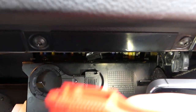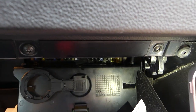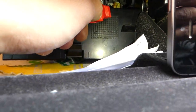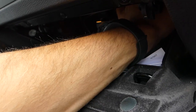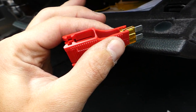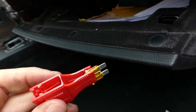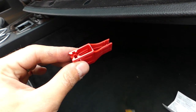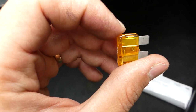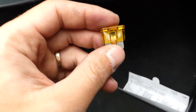I'm using the fuse puller and holding it towards the front — if you put pressure toward the back, you're going to drop the fuse. If you drop it, you need to remove the cover underneath with a few screws to retrieve it, otherwise it will make noise while driving. This fuse is blown — so now we'll pull a 20 amp replacement.